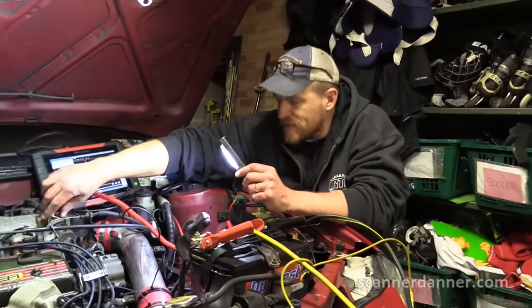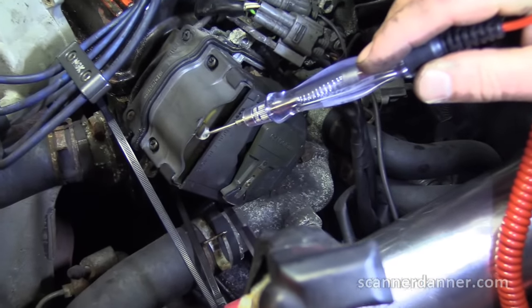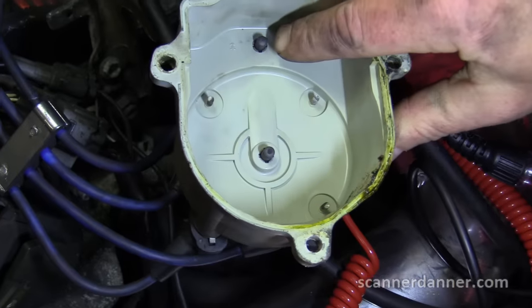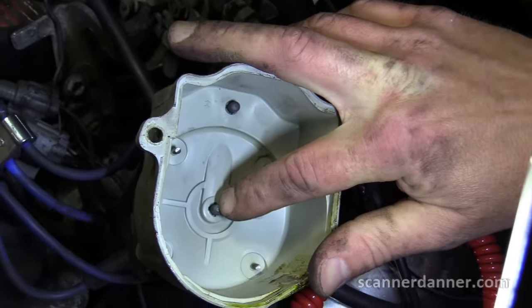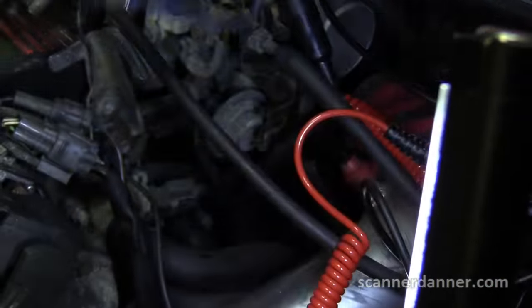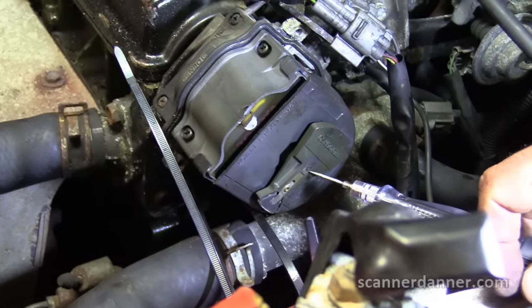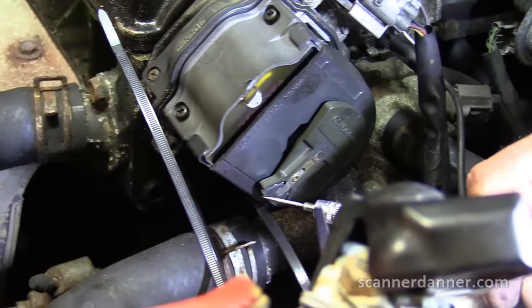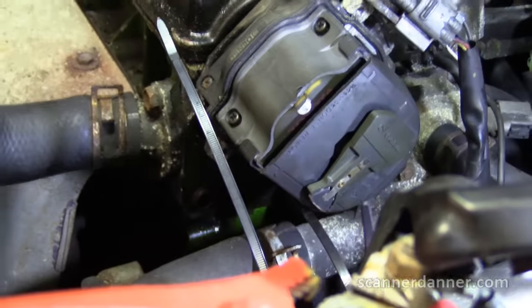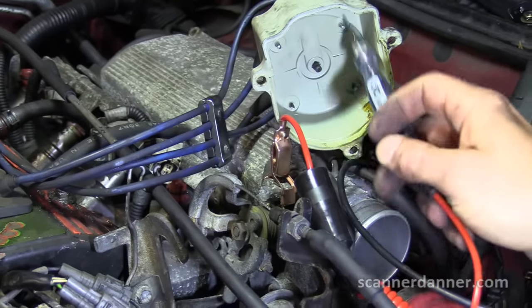What we're going to do is a test on the coil itself. The spark actually comes from here — spark goes into this tab and comes out of this tab. On the distributor, spark comes out of here, runs through a path into the rotor right here, and from there it distributes to these four terminals — one, two, three, four — corresponding to the cylinders.